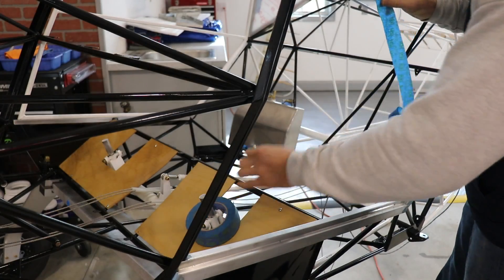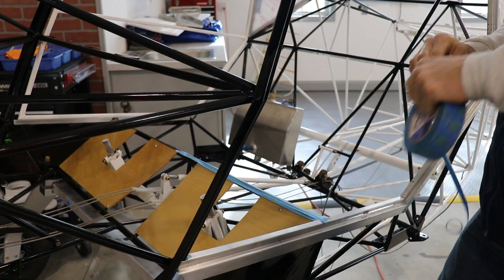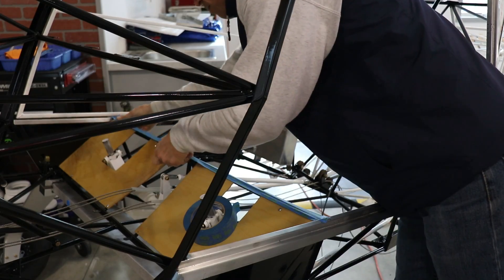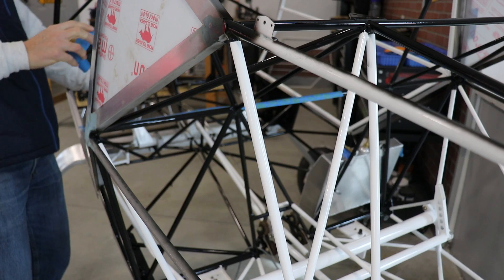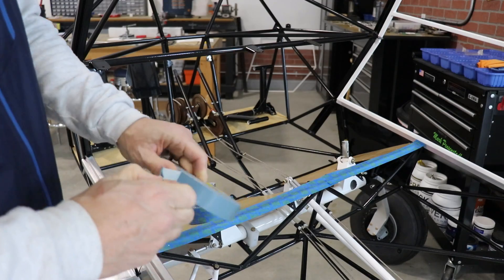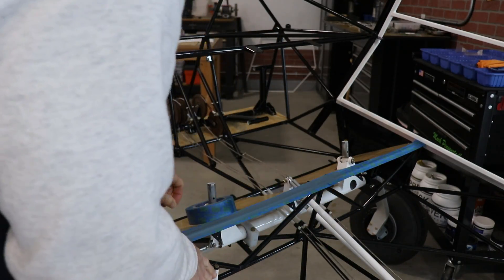I also wanted to put in the seat pan so I can see what kind of room I have to run the wires up front. In order to avoid scratching the paint I temporarily put blue masking tape down over the painted tubes — on the bottom tubes and the top tubes where the seat will rest. I put the masking tape on first because it's a low-stick tape and easy to peel off, and then over it I put one-inch wide duct tape which gives the strength and resistance to scratching, but since there's blue tape under it it'll be easier to peel off later.